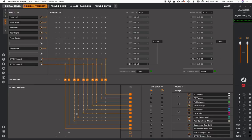And there's also an EQ for the rear speakers, which are run in mono in the car. I won't get into that one too much. I think it's got one band of EQ on it anyway. And then it has a pair of preamp outputs that are fed through yet another pair of EQs. So this particular amplifier gives you 10 channels of 10 band parametric equalization that you can apply, and I'm using 9 of them in this particular tune, so I have access to 90 bands of parametric EQ to tune this car the way it's configured.